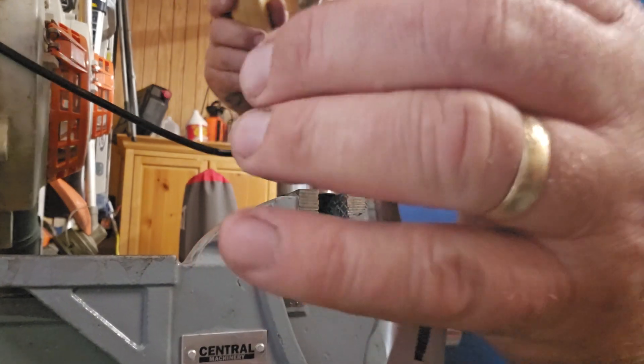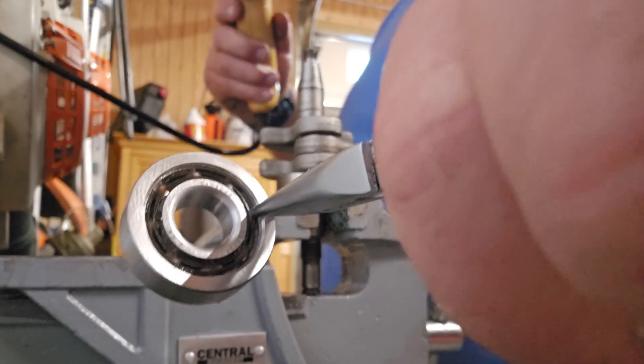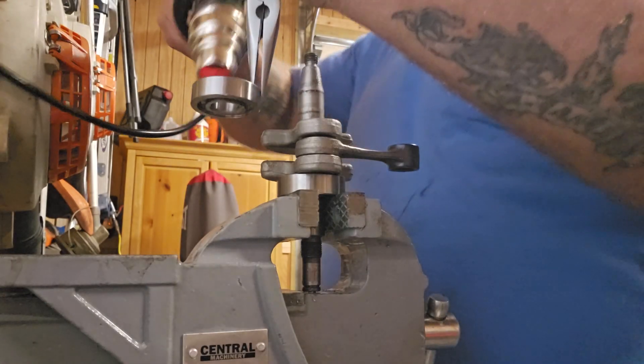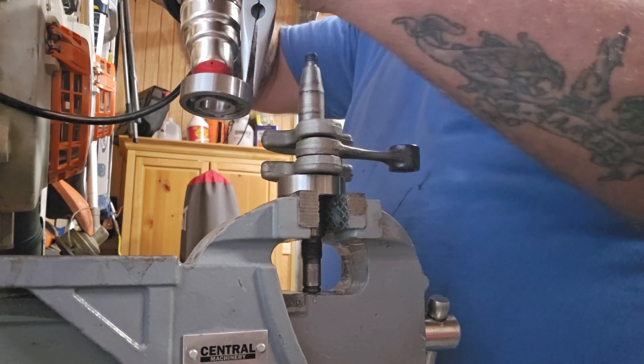Let me make sure I got it right. This particular bearing has a little plastic race on one side — that side goes towards the crank, the other goes away from it. If you don't get it on there correctly and you do have problems.